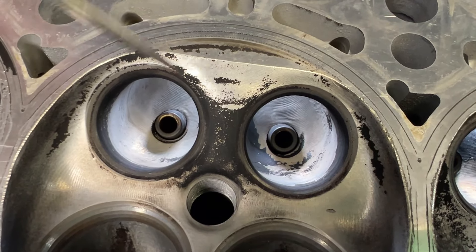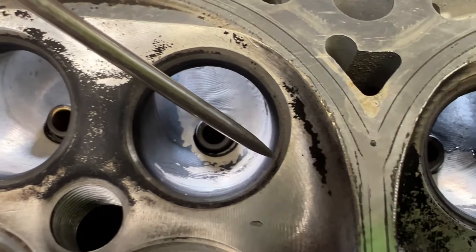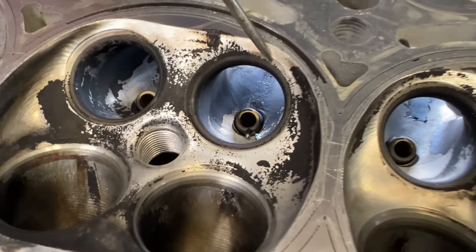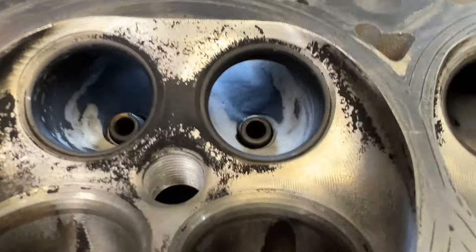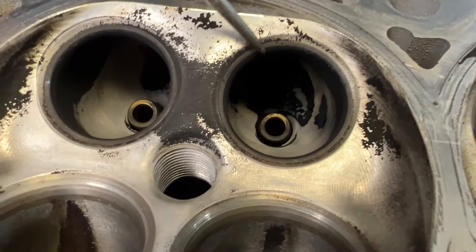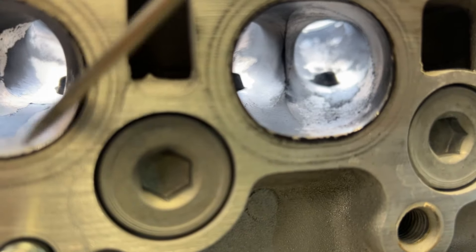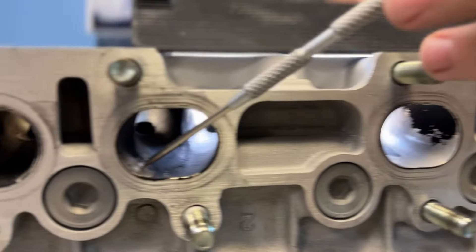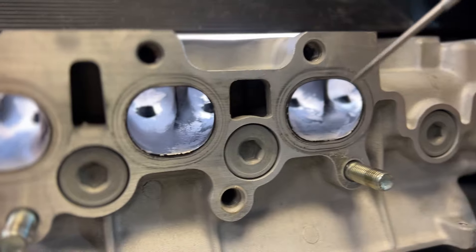As I mentioned, there is a lot of oil deposits here. When you see oil here, it usually means it's going to come from a ring — we'll go over that in a second. The exhaust seats look really freaking good. I checked the valve guides and they look amazing — nice and tight, they actually didn't wear at all. There's not so much oil on this one, but you definitely see a lot on this one. They all have oil; this thing was oiling like crazy.